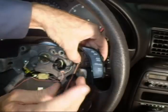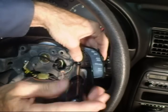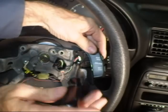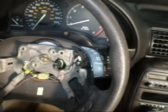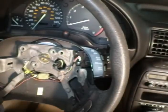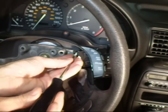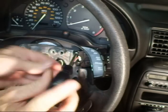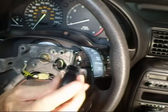After that, it's just a matter of putting the airbag on and hopefully the system works. Now if it doesn't work, you'll have to have the computer programmed to see the cruise. You can either go to the dealer and have it programmed, or go to the junkyard and get a computer out of a car that had cruise and had all the options that your car has.